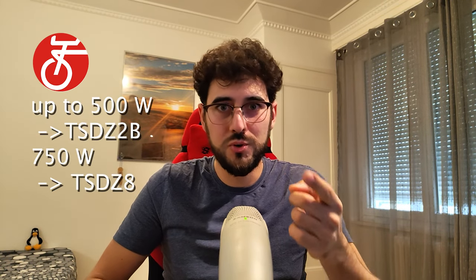If you want to build a 750 watt one, then go for the TSDZ8. It will be well tuned out of the box and it won't suffer from overheating issues. If you need instead something that will assist you no matter what, whether you push for it or just fake it, something easier to tune on the software side and with a great throttle response, a Bafang motor is your choice. Feel free to browse this channel for more in-depth comparison and explanations.